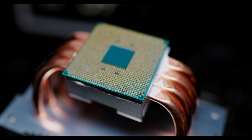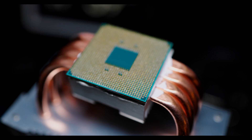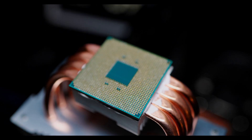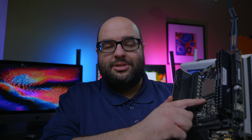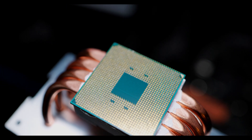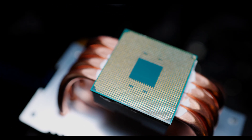Some of you may say you've never had that problem removing coolers from AMD CPUs, but in some cases you can — and it's going to depend on your thermal paste, as some of it adheres a lot more strongly. In my experience, this little bar really isn't enough to hold the CPU in place. Intel does have a better mechanism for that, and since the pins are on the motherboard in Intel's case, the CPU is generally a little bit safer — less susceptible to damage.